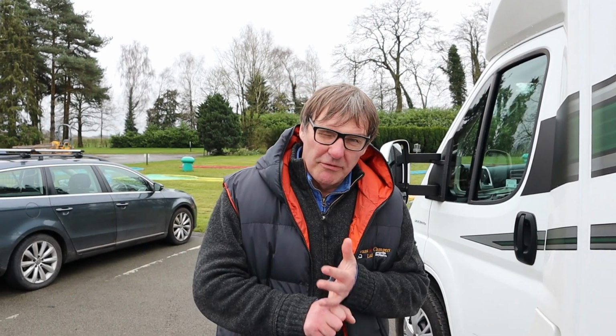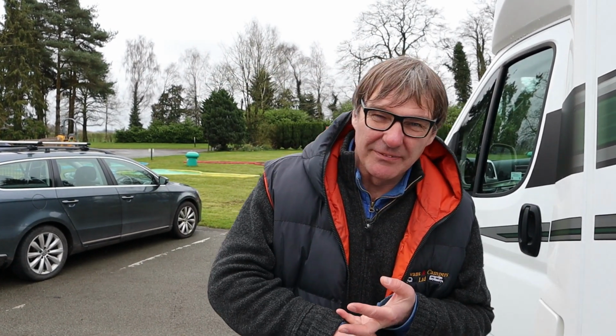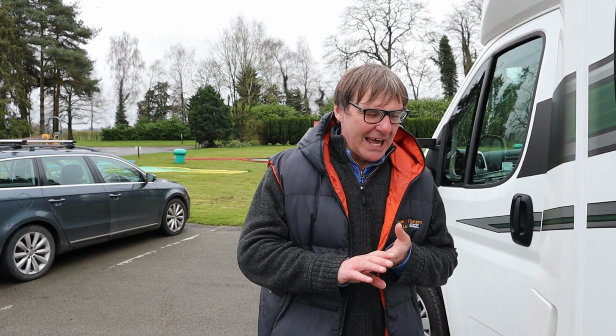So what we've done now is we've done 3 things. We put fresh water into the freshwater tank. We put 240 into the van, so basically anything that needs a plug we can use there, and we've also put the gas on. So now what we've got to do is to prime the van up and get the van all ready. Okay, in order to set the van up, what we need to do is to wake the Bessacarr up. So what we need to do is to go over to the control panel.